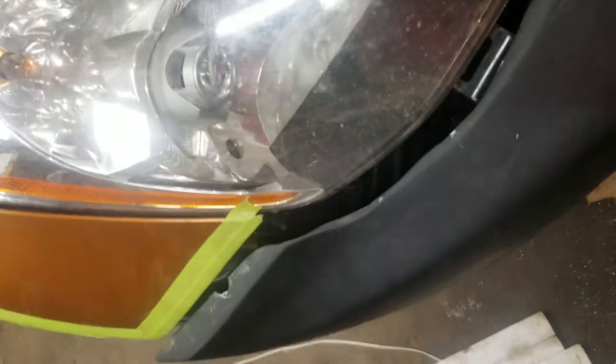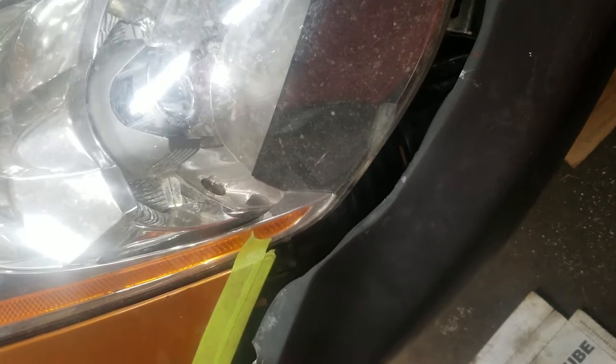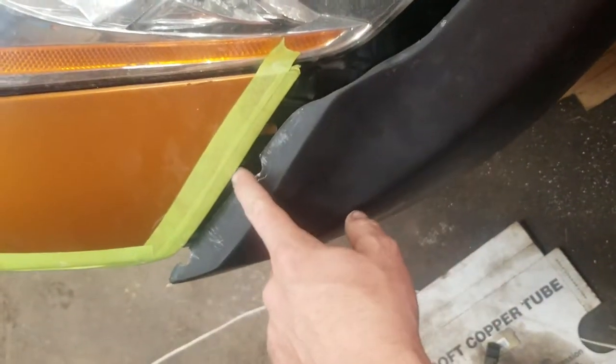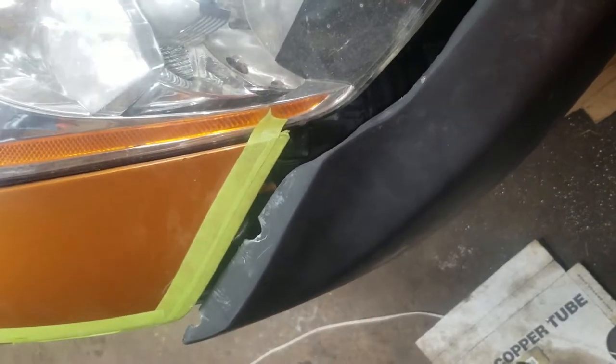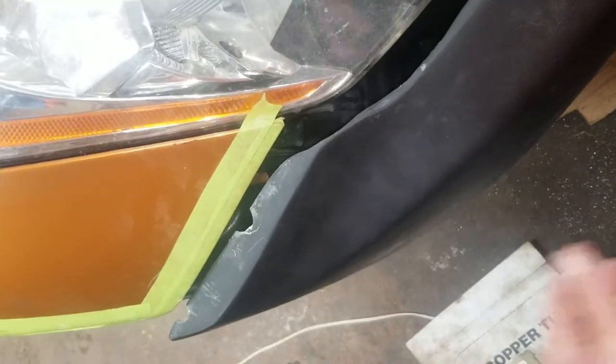Right now, as you can see, I don't have this side bolted in. That's to show you that this flange isn't long enough to use the mounting holes — I had to kind of slot it out just to get washers to hold it. This needs to be almost an inch longer, at least half an inch, to be able to have holes drilled in it to fit the stock mounting holes.